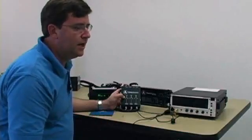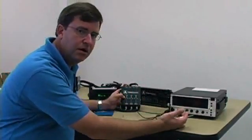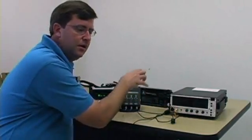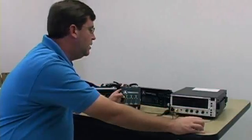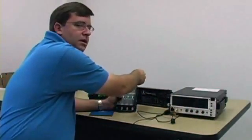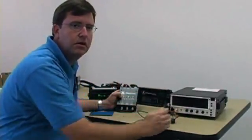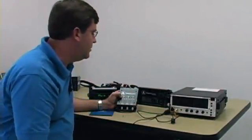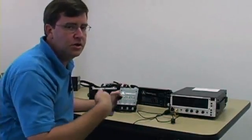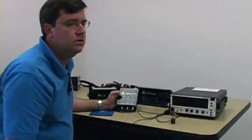In some really exotic situations, you may actually have a three-way front and a three-way rear in a car. In that case, you would need two SSIs to sum each front and rear section, and then take the output of the second one and splice it into the harness feeding the DSP unit, so you have a distinct front and rear signal with full fading capability. You can achieve that even with two three-way setups by simply using two of the units.